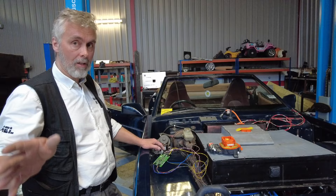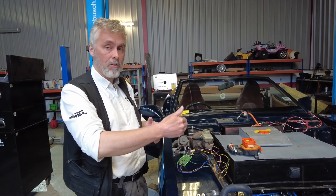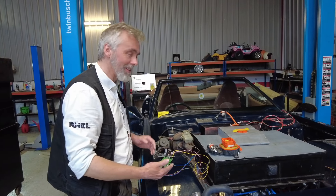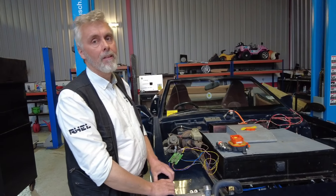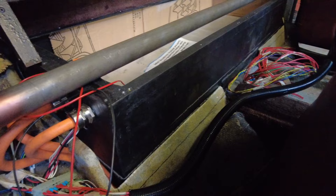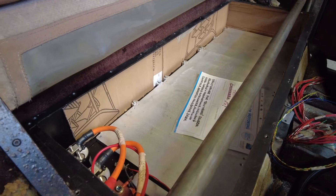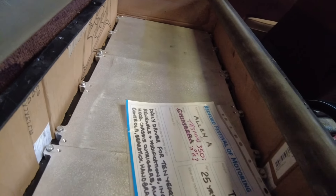For the lights and other non-critical stuff — like disco lights and other nonsense — we put that in a separate controller. That way if we have to modify it because you want a different disco mode, we don't have to revisit the safety-critical bit; it just separates the two out. And there's quite a lot of HV cabling going on here now, so it's really starting to take shape. So why is there cardboard in the battery box?